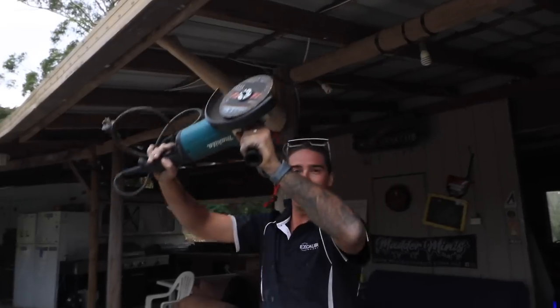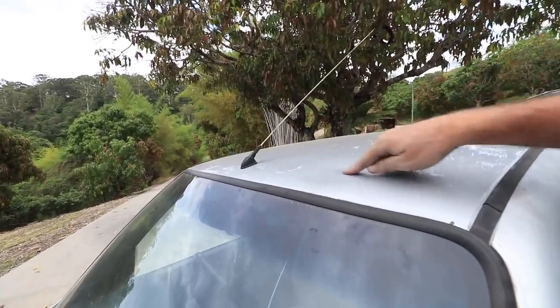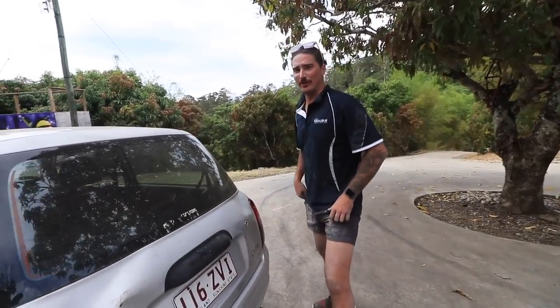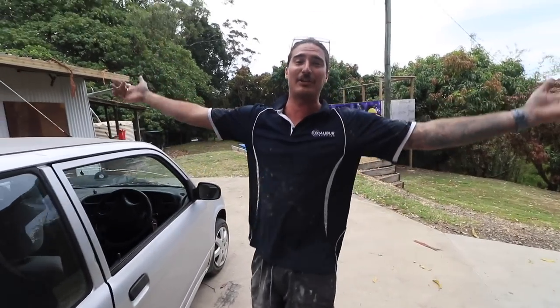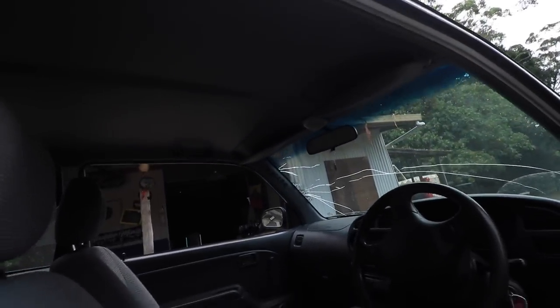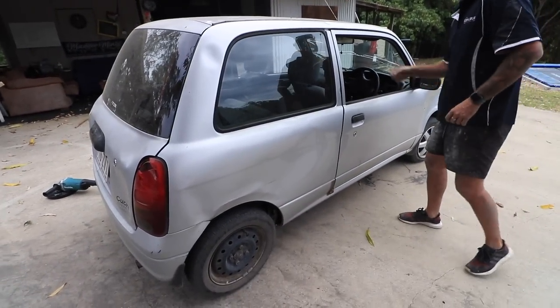You're probably wondering how we're gonna do this — Gecko's got the answer. We're gonna cut across here. I want to keep the windscreen and the antenna because I like the radio. We'll come across here, down and straight across the back, take this back window out. We'll strap it so it's more like a ute. We want to take the roof lining out first so we know there's no electronics in it, then take the glass off — you don't want to be grinding around glass. We'll be as safe as we possibly can.